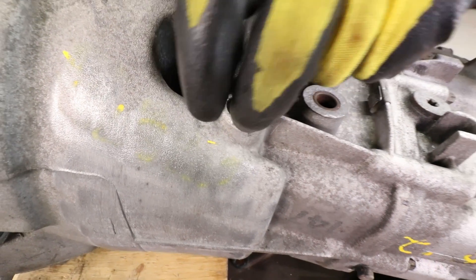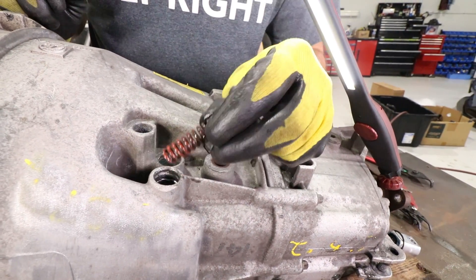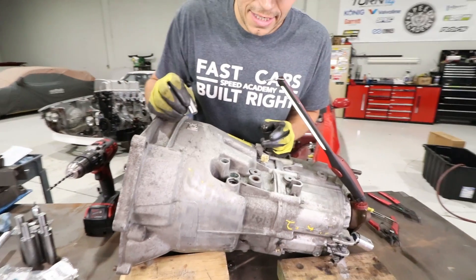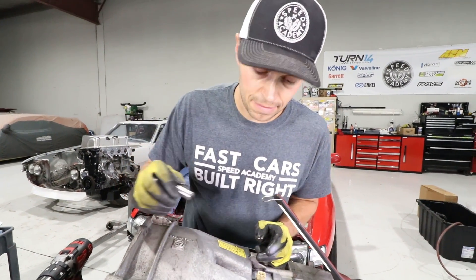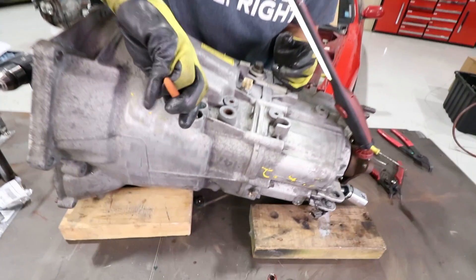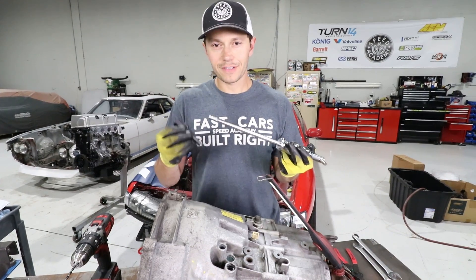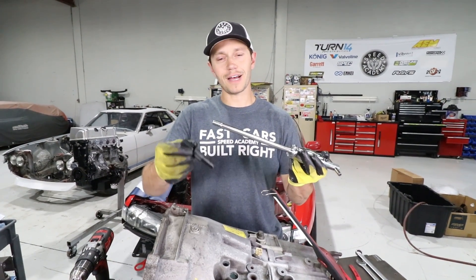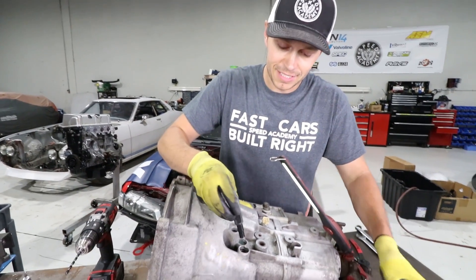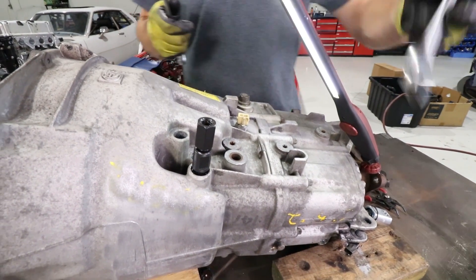That is the spring - this one we'll actually be reusing. Apparently the fifth and reverse springs are different, so you don't want to mix these up, so I'm going to do these one at a time. The next job is replacing that sleeve in there. These can get stuck and be very difficult to remove. One downside to this job is you may have to go out and buy a blind bearing puller kit, which is what we had to do. It's certainly not cheap - it can range anywhere from $100 to $200 depending on what brand you buy, but it's pretty essential.